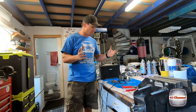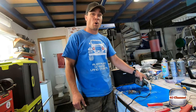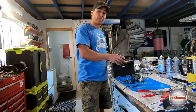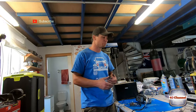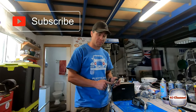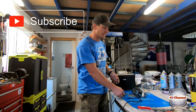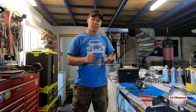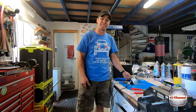That's our wiper motor completed and restored. The wiring loom's done — thanks to Richie and Jared. We stripped down the entire wiper motor, gave it a grease-up, cleaned up the commutator, checked all the brushes, and cleaned all the internal stuff. When we first got it going it was clicking, clunking, and making terrible noises and we couldn't get the parked position to work. We ended up opening up the park switch — which is a very simple switch — and cleaned all the terminals inside. At the end of the day it really comes down to making sure all your terminals are clean: a little bit of emery paper and some contact cleaner and it'll come up like new.